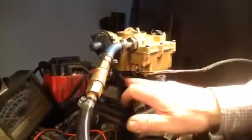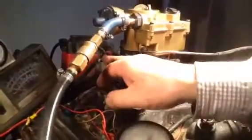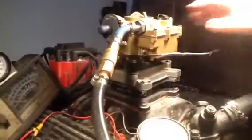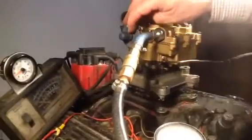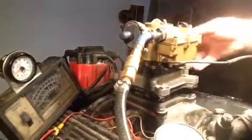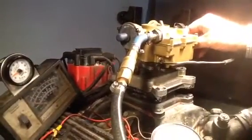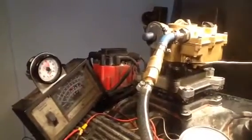Here's your center carburetor. No numbers, of course. It's got all the way through the shaft, so you come up here and you can put your other two on this one the way it's supposed to be with the progressive linkage. Now you can drive all day long in this carburetor. We've got it set up for a heat-type choke here, but we can convert that to electric for you at no charge. If it were mine, I would have the electric on there.